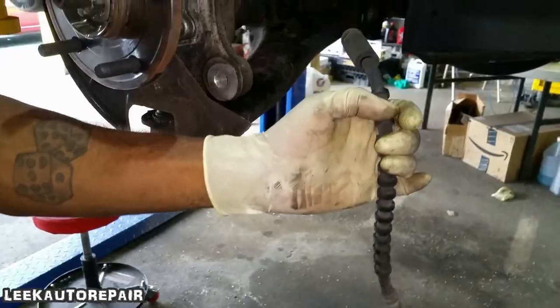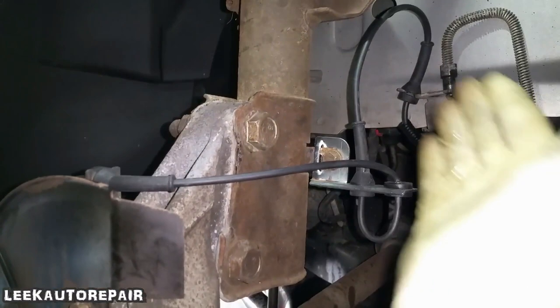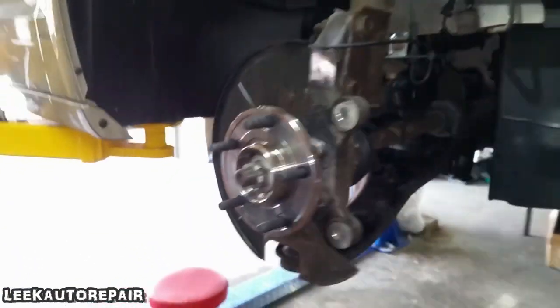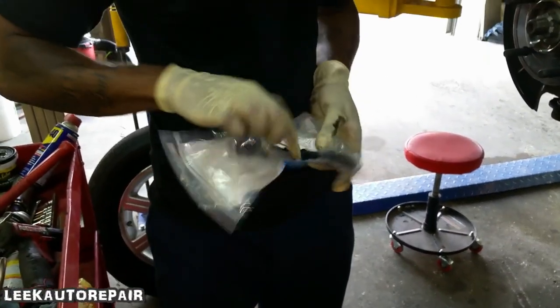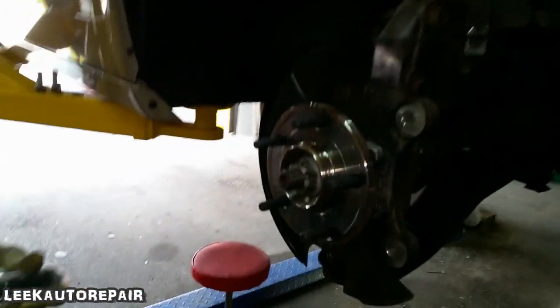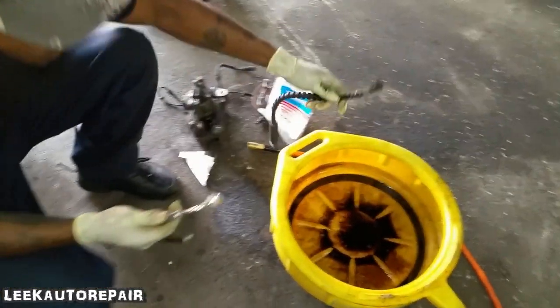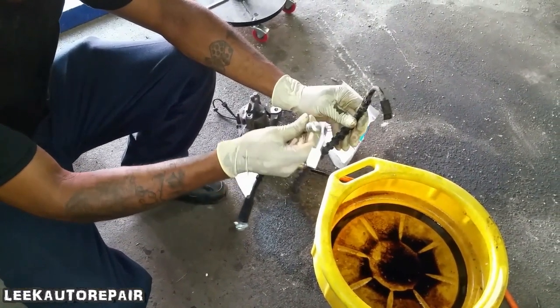This is the brake hose — got it pulled. Now you see this? It's not sealed, there's air in the system, so I'm going to repeat this: bleed all four wheels. Get the brake hose out of the bracket. Make sure you get all your hardware — I've got my two washers right here. Compare your new brake hose to the old one, make sure it looks right. Put it on — yup, looks good.